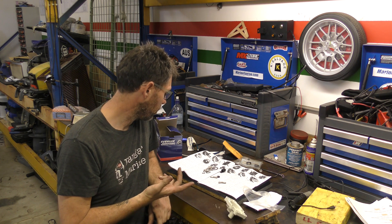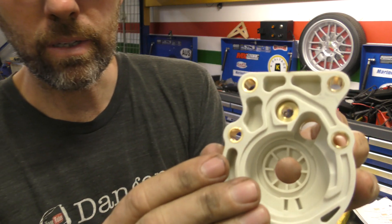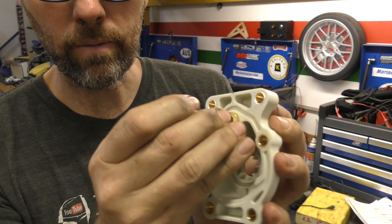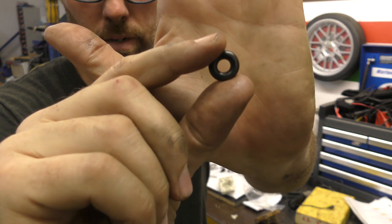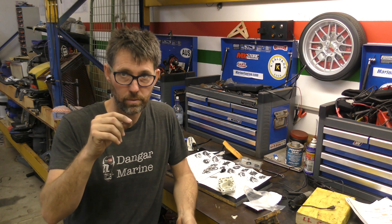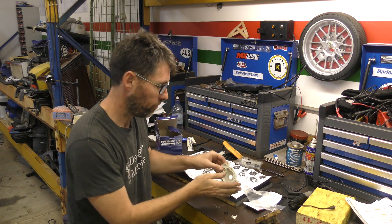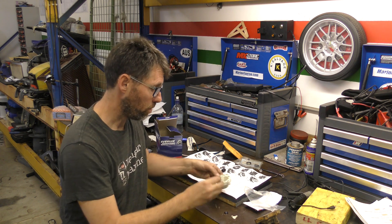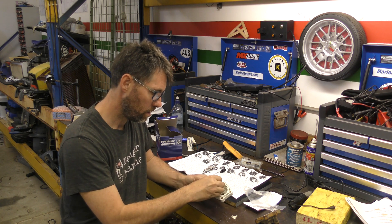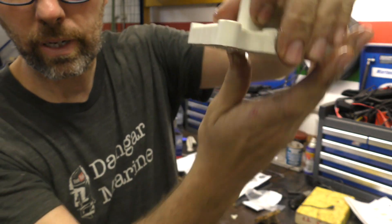The first step is to oil and install the shift rod bushing, which is actually pre-installed here — there's a bit of tape over it to stop it falling out. The next step is to put an o-ring in here that'll hold that bushing in. This is the o-ring — quite a small but fat o-ring — and it seals around the shift linkage. They say to oil it rather than grease it, so I'm just going to dip it in a bit of oil. Drop the bushing in some oil too, then push that in and push this o-ring in. With the o-ring in, it can't fall out anymore.